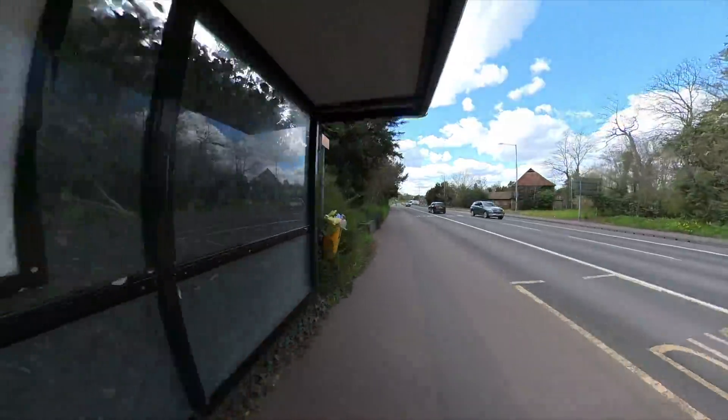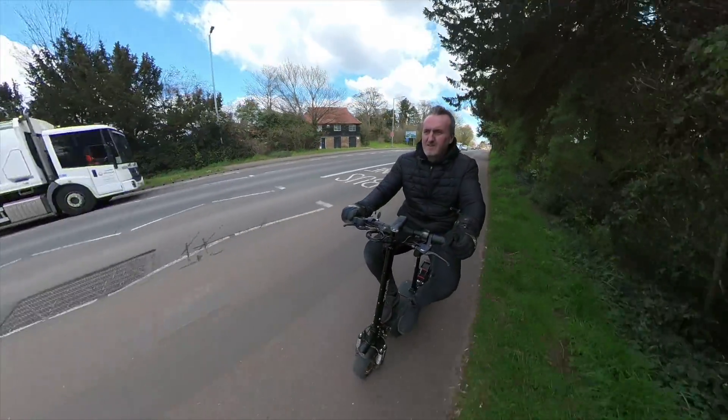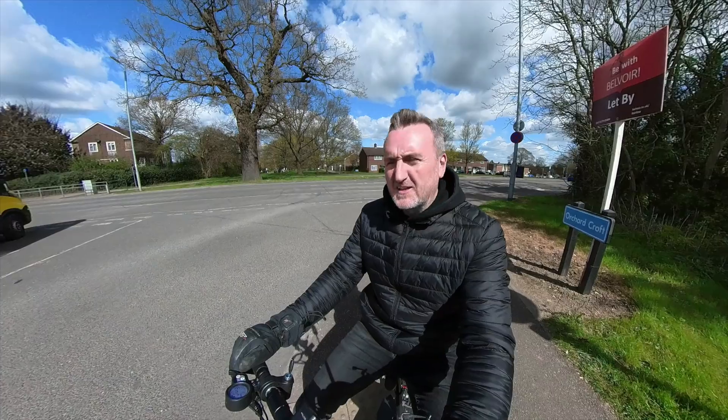That is a really common thing to happen, so you've got to watch out — always get your wires for your hub motor and route them to the frame so that nothing can actually chafe them. The other thing you've got to watch out for is on your brake disc: the little screws that hold the brake discs onto the hub — make sure they're lock-tited or just really tight, because if they come out they can actually chafe that wire as well and cause a break, and then you'll basically be stranded. Also if those phase wires touch, you're probably going to end up with your controller going up in smoke.